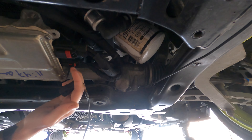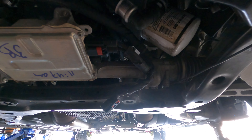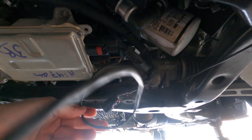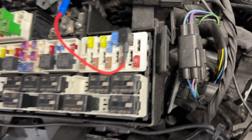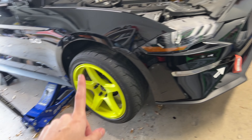I've got you guys set up with me under the car. Looks like there are two plugs on this and we're only going to be undoing one - just this little one right here. This should be as simple as zip-tying that one out of the way, plugging this one in, and routing this cable up to a fuse panel. We have our cord run up and mounted - we have a ground and this is run off of an unused fuse that does have signal upon start according to the diagram.